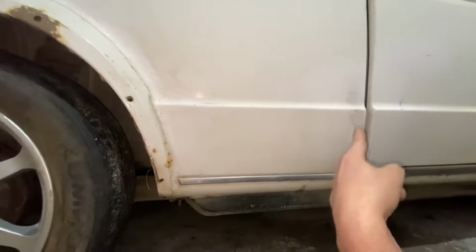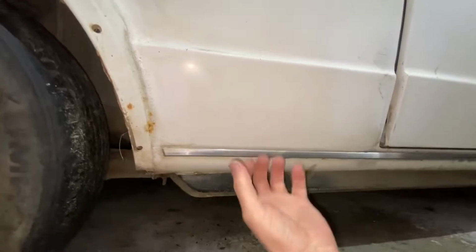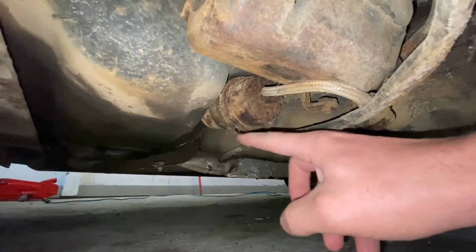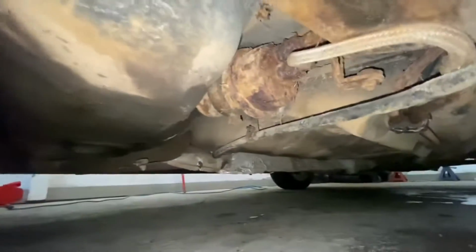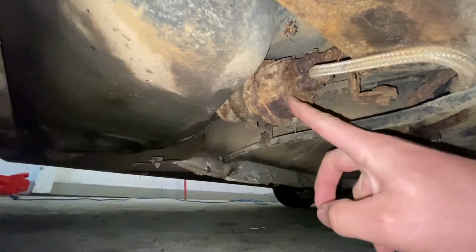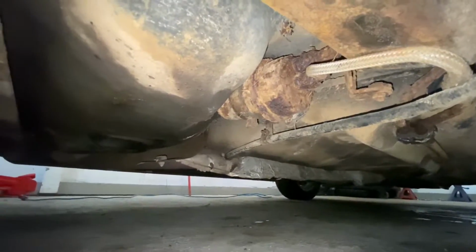So the gasoline flows from the tank into the fuel pump, right? The fuel pump pressurizes it. Then it goes into this accumulator, which basically keeps pressure when you turn the car off. So then when you go to restart it, it gives pressure. If you were to bypass this thing, you would just have to crank longer for the car to start. So that's what that is, fuel accumulator. And then from that, it goes over to the front to the fuel injection system, right?